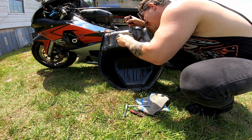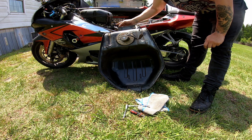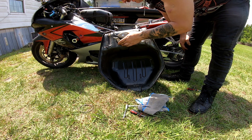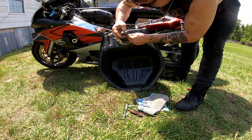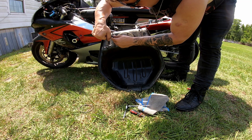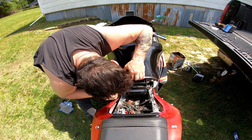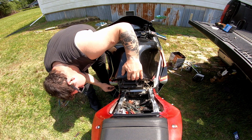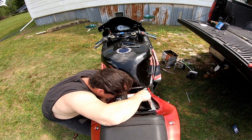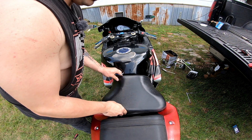You just got to squeeze — think skinny. There we go. If you remember correctly, we had a fuel line that goes directly to this side — if I were to put the tank on, it would need to go directly to this side. I had it backwards. We'll take our bolts, tighten them back down. Remember, just like a wheel and there is a gasket, so we're going to want to do the star pattern — one, two, three, four, five. Go just snug on the first time, then go back around and get them tight. Hope and pray we have enough gas to start it. Connect the electrical connector and the fuel line, get our bolts, get our tank back on and we'll see just how well she works.